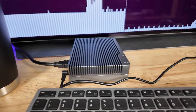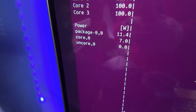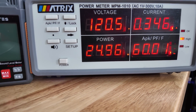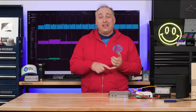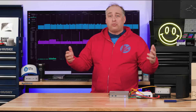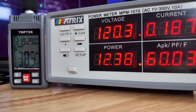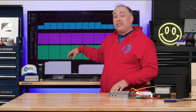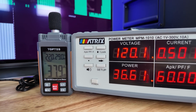For the N100 version, package power consumption is about 3 to 5 watts at idle, and the overall system runs at maybe 10 to 13 watts at idle. Under load, package power goes up to 10 to 12 watts, and the system level reaches the low to mid 20s in watts. The N305 unit is a bit different: idle package power is pretty close at 4 to 5 watts, and system idle is maybe 10 to 15 watts — close to the N100. Under StressNG load, the N305 package hits about 19 watts, and the overall system runs in the 35 to 37 watt range.